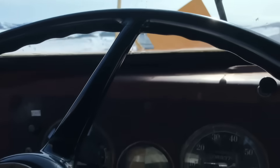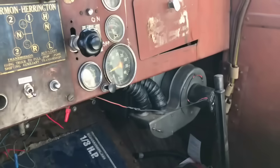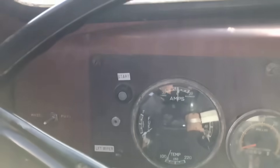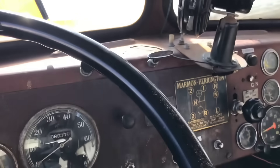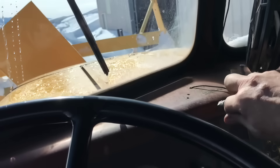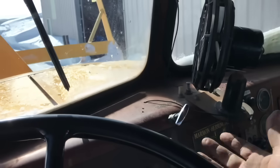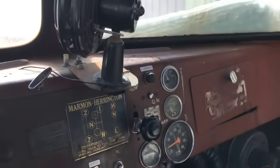I'm going to give you a quick tour of how you actually start these two engines and drive this truck. The first thing you do is turn on the key for the front engine, which is the truck engine. Make sure you're out of gear. If it's warm, you don't need to choke it, but the choke is right here if you do. The start button is right there. It starts and runs very, very well. There's a throttle up on the dash — it's like a gas pedal but you can lock it into a certain RPM and it will drive.